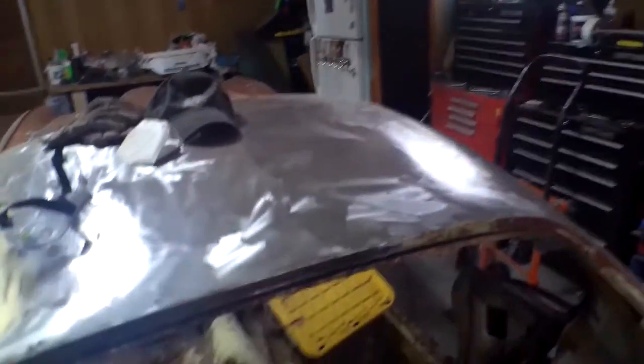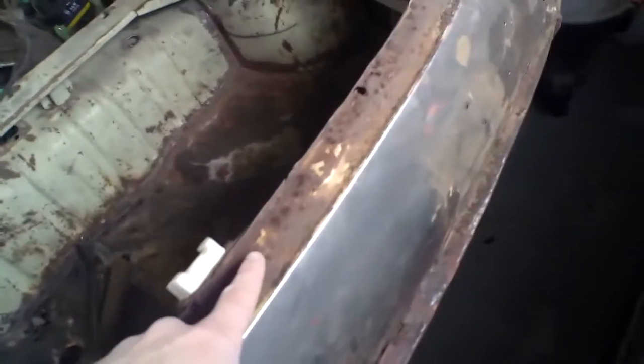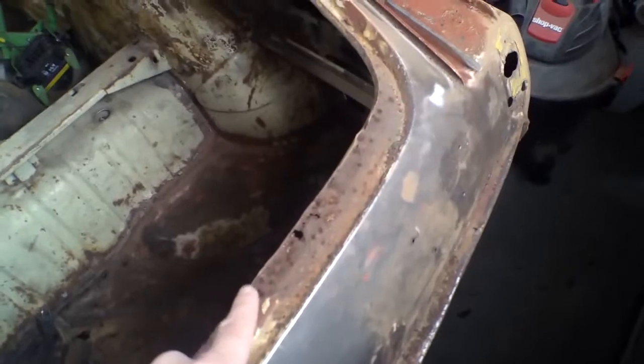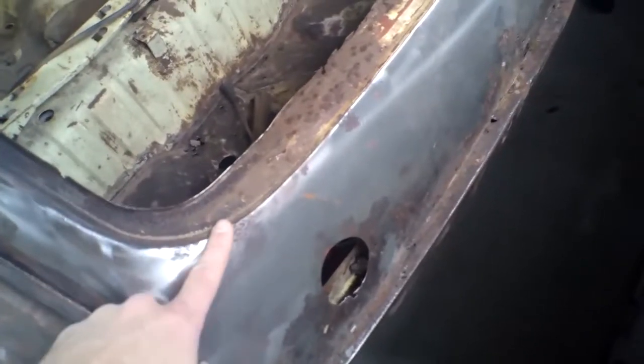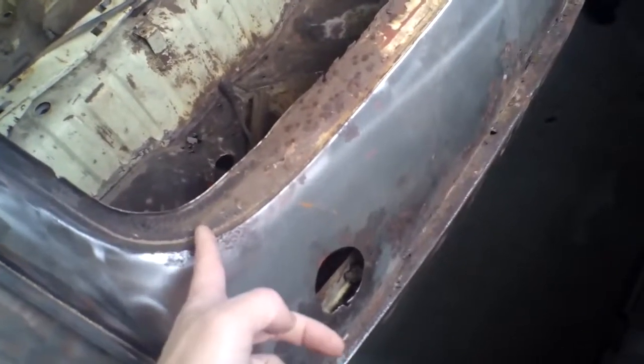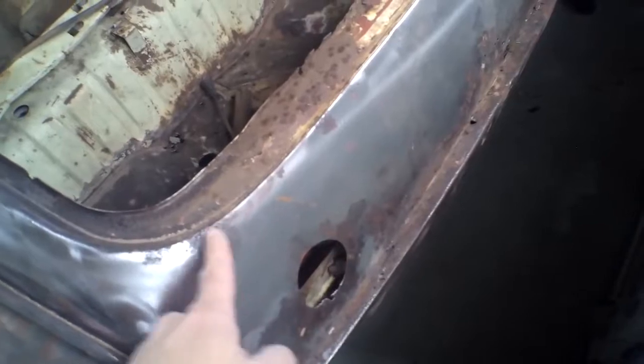The roof's looking good. There's a lot of this little stuff here that's rusty. Apparently water is very easy to sit and collect in here, because also the hatch is just really rusty. What I'm planning on doing is — here on the corners I can see where the water was accumulating — I'm just later going to cut some little drainage channels out of there so that it can drain and that'll help prevent more rust in the future.